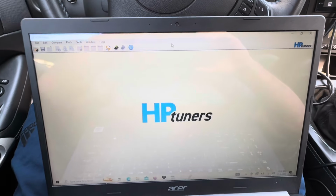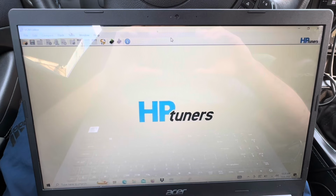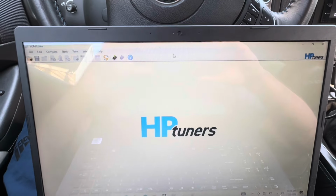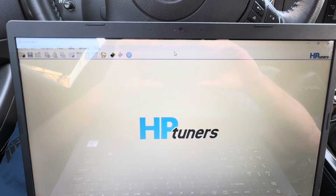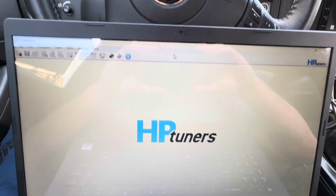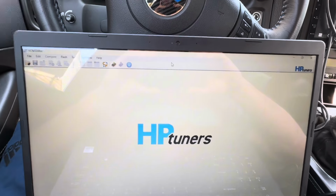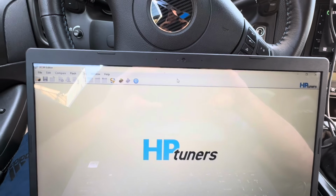Okay, so sorry, I actually just missed one of the steps. After you're done reading the tune, it's going to come up and give you a menu to save the tune. Obviously, title the tune however you want, save it to whatever folder you want, and then you're going to have your tune saved. After that, you're going to want to turn the ignition to the off position and let it stay off for about 15 or 20 seconds. Anytime you're writing a tune or anything like that, once you're done, you want to turn the ignition completely off and then wait about 15 or 20 seconds.